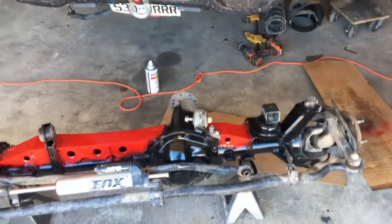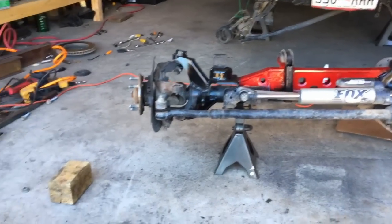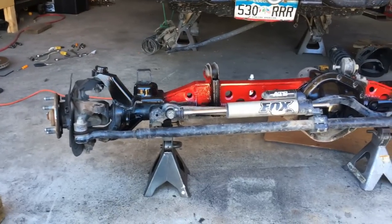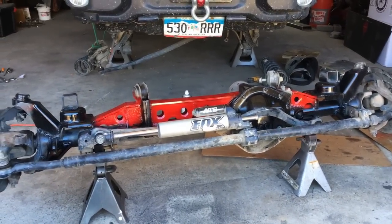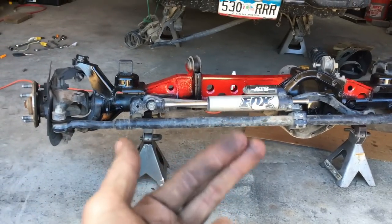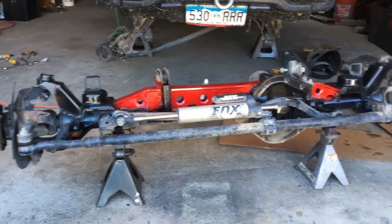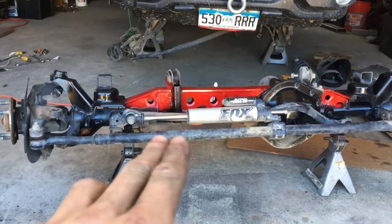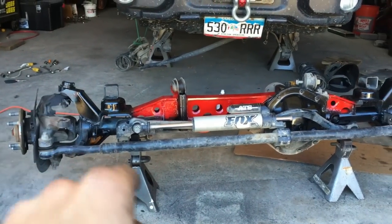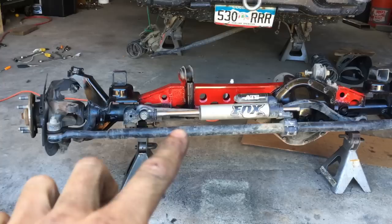This is a great kit — cheap insurance. Axles bend, it happens; the tubing isn't that thick, and these are more of a hybrid Dana 44 where it's a 44 differential but the rest is basically a 30. I highly recommend it. Next step would be lower control arm skid plates — if you hit those guys and bash out your welds, you'll lose your whole mount. As for truss versus sleeves: some companies make a hammer-and-sleeve design which is the best sleeve option, but other sleeve kits require you to drill rosette weld holes through the entire tubing, which I don't really recommend.